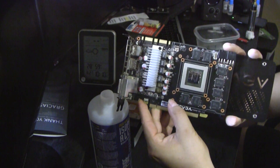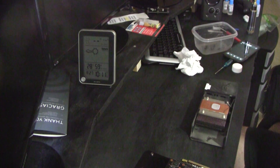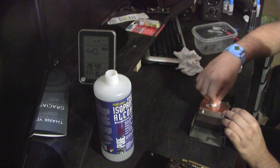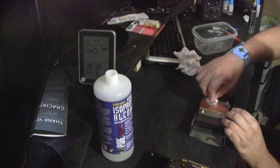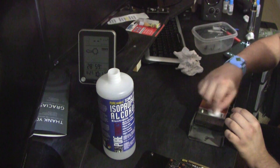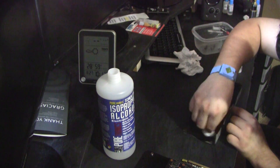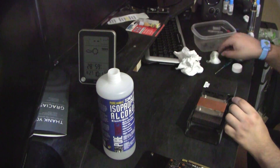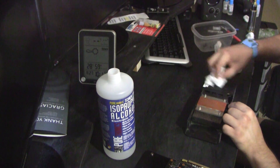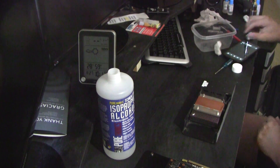There's the clear GPU die right there — the chip. Now I'm going to clean off the stock heat sink using 99.9% isopropyl alcohol. It's cleaning up great, just comes right off — I'm pretty sure the paste had dried right up. Make sure you clean off all the thermal paste. It looks freshly clean.